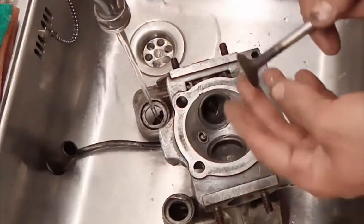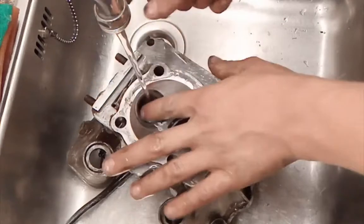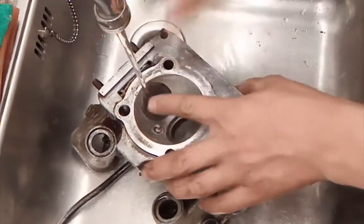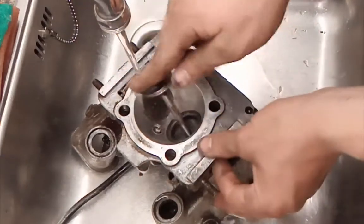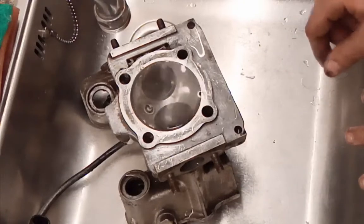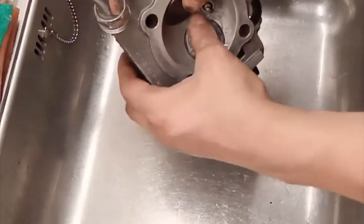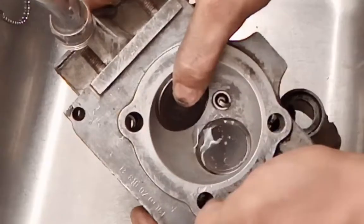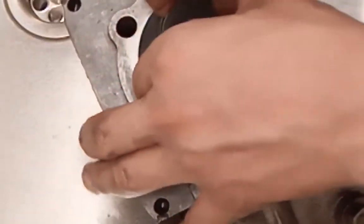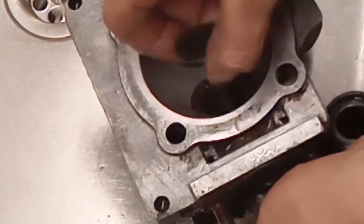So when you've ground just a bit — not a lot, just a bit — when you put both valves in and it isn't leaking, then it's good. I'll just give it a try. It's easier to see if you put tape over it, but just put it in there and then you can see if it drips. I'm going to put it on the side. This one is not the best, but not too bad. This one is the finer one. The bigger valves should seal just as good as the small ones, but sometimes it is a bit of work.